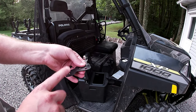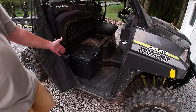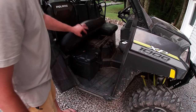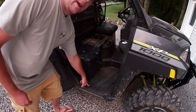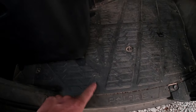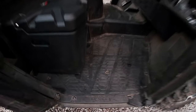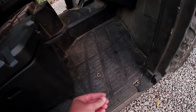So I'll go ahead and assemble this and put all the brackets on. They want the box all the way against the middle and back as far as it can go. There's no bracket on the inside back — just two up front and one on the back side — so when the seat goes down it's in line with the seat and doesn't stick out. There are little template holes already on the Polaris floor, though they don't line up with this. I'll drill my holes there — not very deep. These are little Allen-head self-tappers; they don't include the wrench, so you'll need your own. I had to shave some plastic off from the molds with a knife.